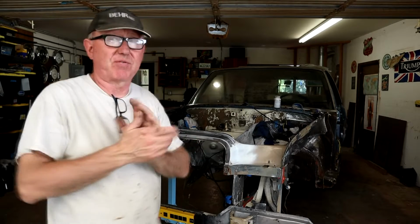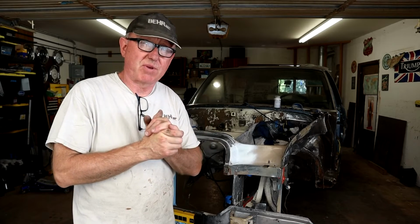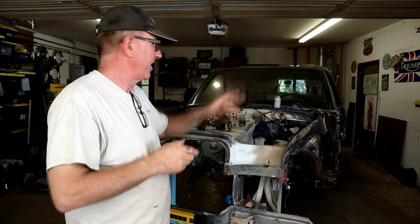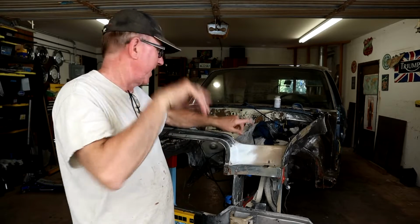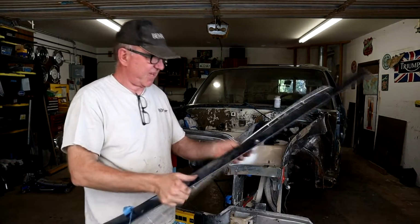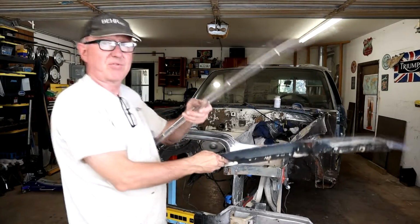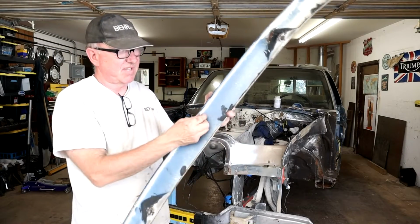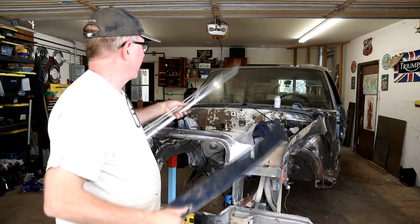First of all, it's pretty straightforward. Obviously you have to take off the windscreen wipers, which is a couple of 13 or 14 mil nuts, and then various Phillips screws all along the valance there, and disconnect the water washer. Let me get it and I'll show you. Here we go. As you know, this sits up there, and then there you've got this chrome trim. Pretty straightforward to take off, and then just disconnect the water feeder pipe into that.